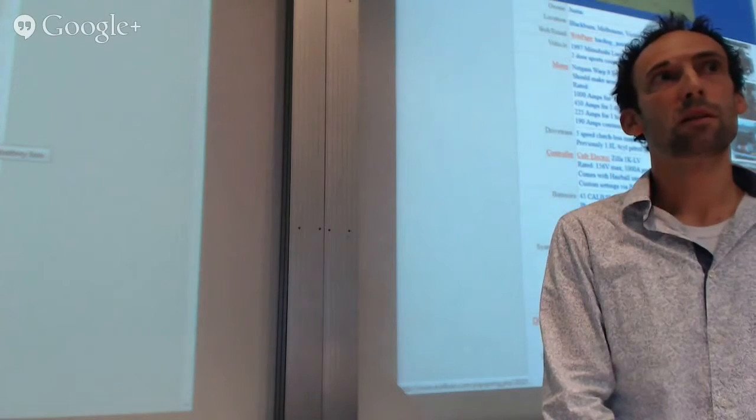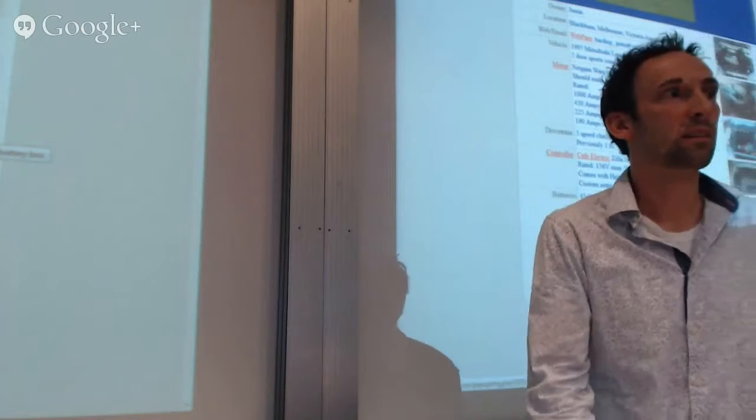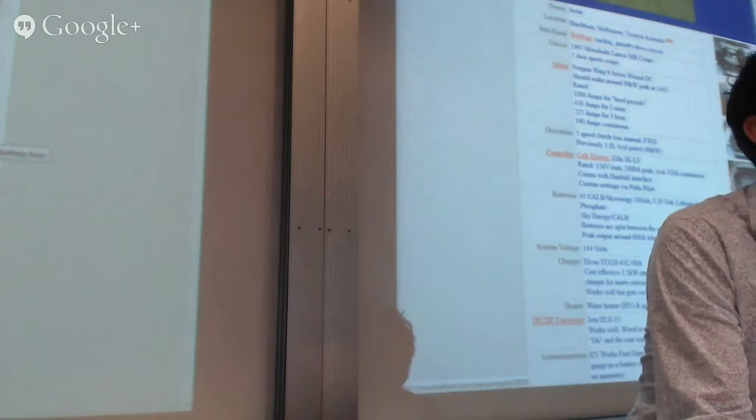I'm actually considering a motorcycle conversion, and was thinking of bypassing the gearbox, because it gives me extra battery storage. Yeah, if you can, it's definitely good. It takes out complexity. You just have to make sure that the motor and controller is happy to work over the wider rev range. Would that save much weight? Probably not heaps in a motorbike. In a car, the gearbox is a fair chunk, I don't know, 40 or 50 kilograms. If you're using the right system where you don't need it, you can. I've almost got halfway through a motorcycle.